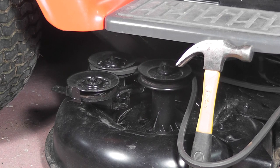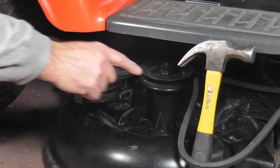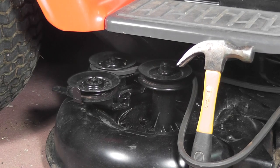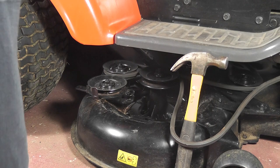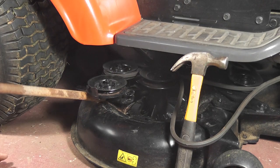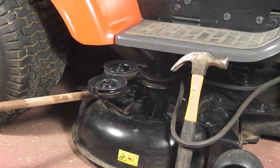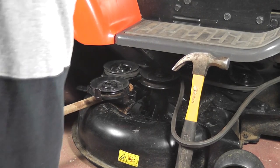Use a stick of wood or tool to take up any slack on the belt. Now you have to loop the belt round the outside rear pulley, which is spring tensioned. For this, you will need the steel bar again. Insert the end of the bar to the left of the tensioning pulley support and underneath the spring. Thrust the bar forward enough to get a solid purchase on the inside pulley support.